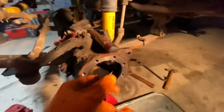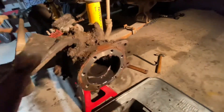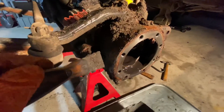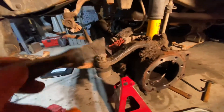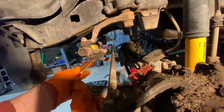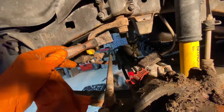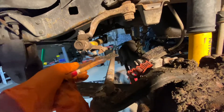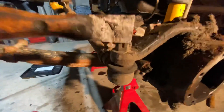This whole thing will look a hundred times better. This thing is just such an absolute mess — as I'm scraping it off you can see it's just years and years of like a half inch thick grease. Essentially all we're doing is pulling the tie rod. You got your drag link, your pitman arm, and your tie rod, so we're just disconnecting the tie rod.